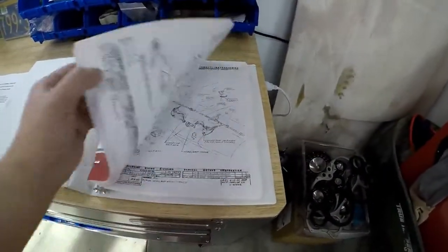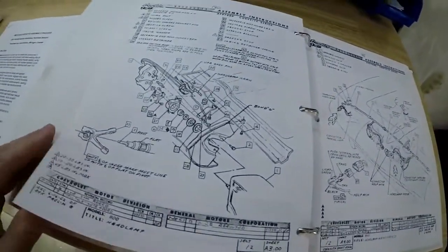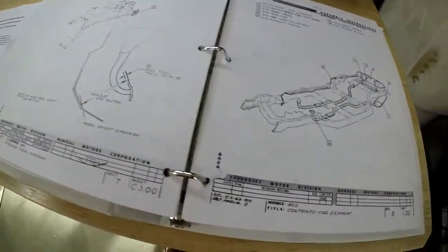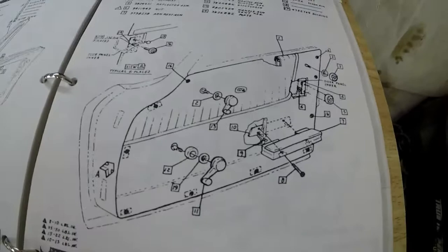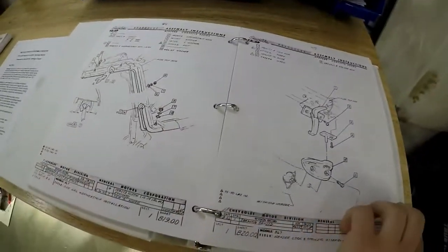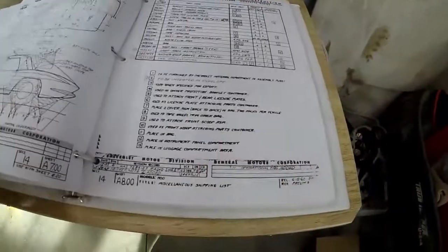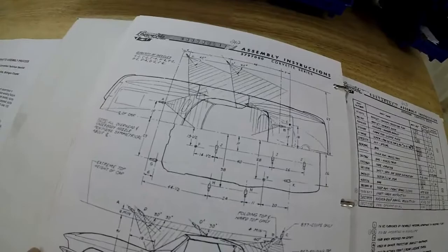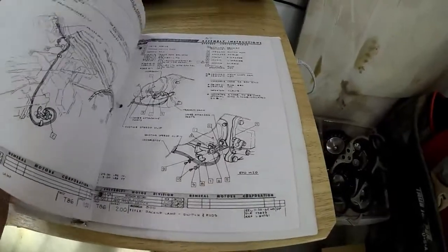Number one, we have the assembly manual, which is a copy of the original hand-drawn details for the 63. You can see there's the headlight install — all these were hand-drawn, which is pretty crazy to think that somebody sat here and drafted all of these drawings just for the guys to assemble the cars. This is really crucial because you can get all of your torque specs. It really helps in the chassis section. You can see here's where they tested with water to make sure the doors and windows didn't leak. It's always a good reference and a good place to start to figure out how something went together.